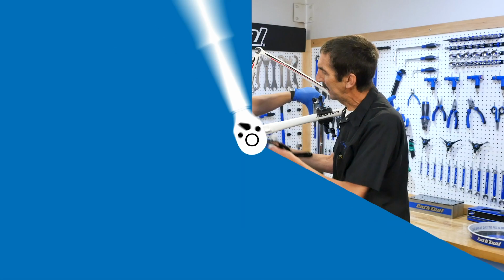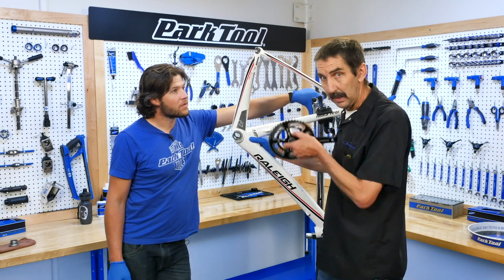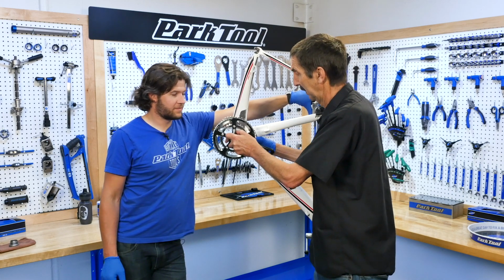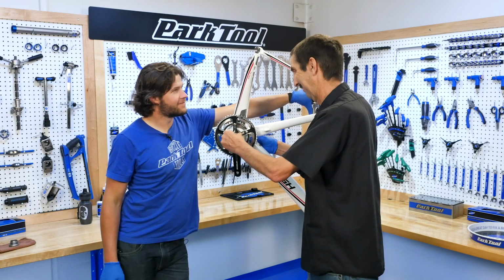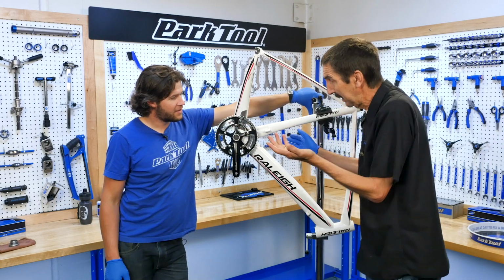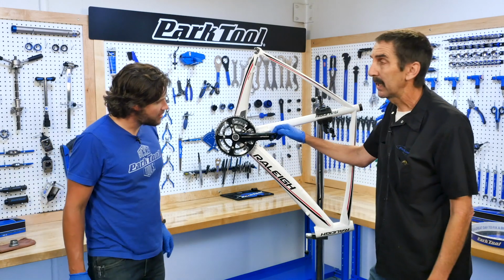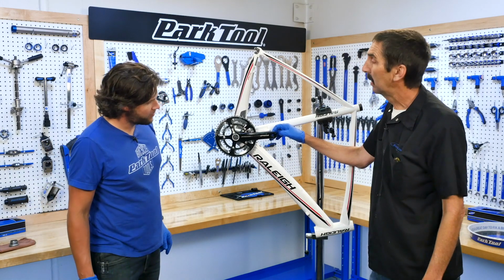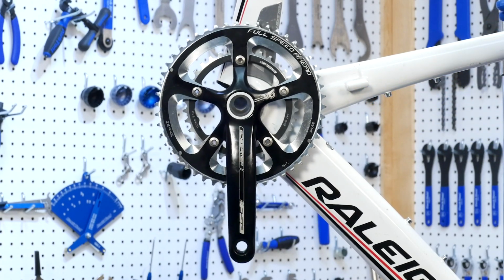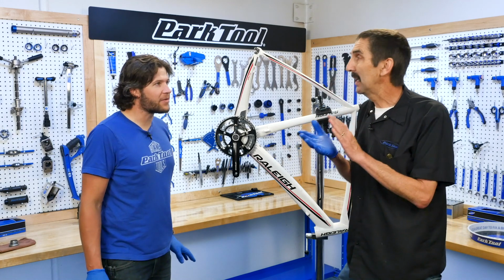So Truman, what I've gotten there is PPL, both sides, 1 cc per bearing. We're going to do the swing test. Time to swing. In it goes, all the way. Perfect. Now let's pick horizontal, nice and parallel. So it's going to go over to you, we're going to count. Everyone out there counting? 1, 2, 3, 4, 5, 6, 7, 8, 9, a smidge. I think we got some consistency.